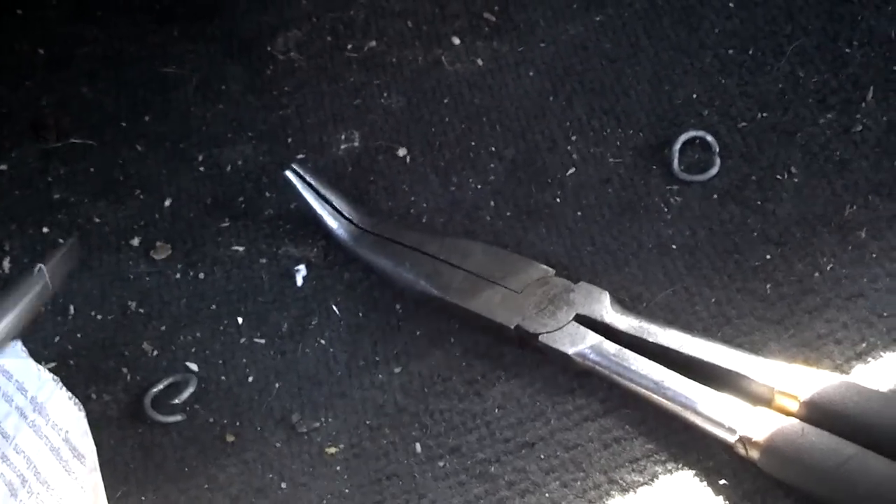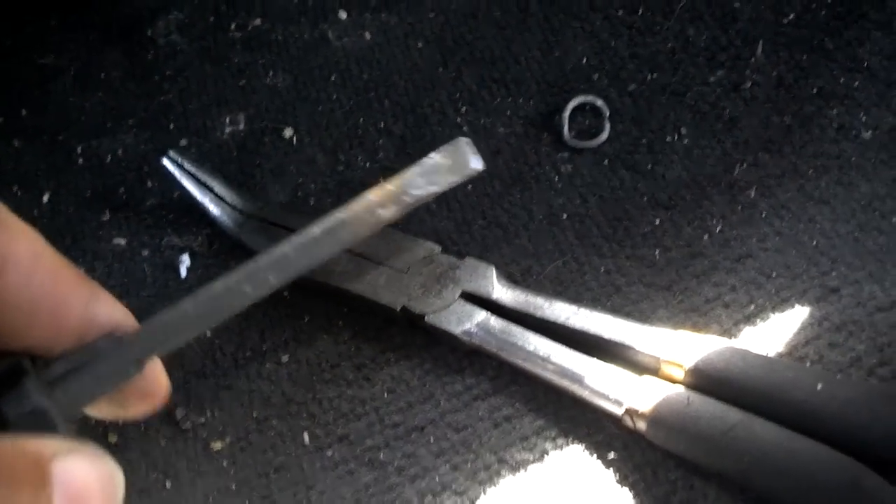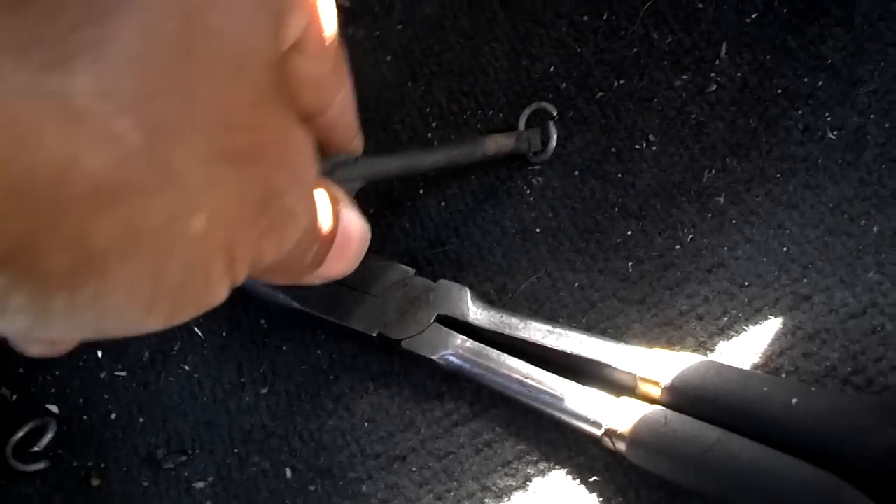On the seat I'm working on I don't see those releases, so what I'm going to do is go down to the hinge of the seat and take loose these bull clips — I'll pop all four or five of them loose across the bottom. I couldn't get a good grip on them with my needle nose, so I took a flat tip screwdriver, pried it under the ring, turned it 180 degrees, and that got the clip where I could get it loose.